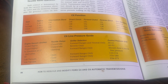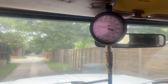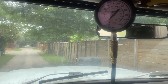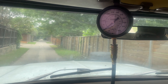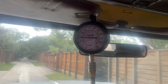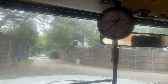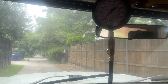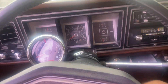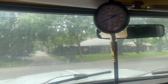We'll see how the truck drives now. It's in reverse now, going back to neutral — we're below that 60 number. Putting it in drive now, and as I drive just keep an eye on the gauge. You saw that as I got close to wide open throttle, I got close to 150 PSI. I didn't upshift, or maybe I did. Now I'm stopped — looks like I'm back in first.